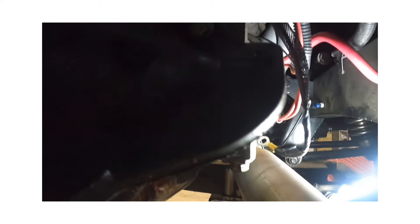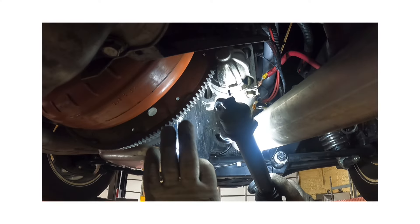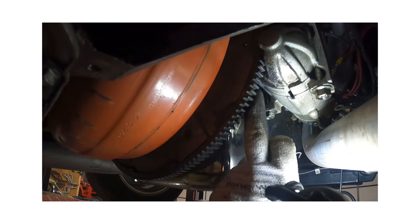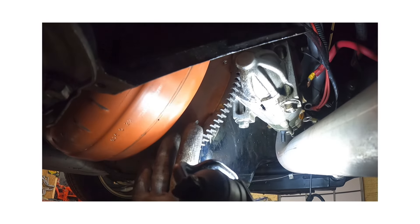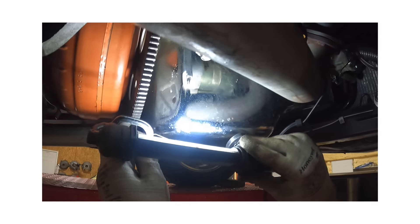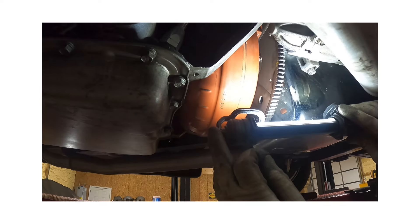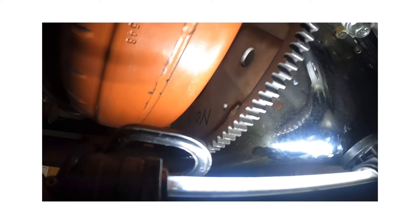I'm going to show you the shims that come with the starter. It's shimmed out too far — what was probably happening is if it's too close, it crashes the Bendix pinion into the flywheel, so it won't necessarily engage. It has tapers on the teeth to prevent that. But especially on a GM, you can see where it was starting to eat it. The flex plate's not happy — it's going to eat this flex plate up. See all those marks, all those high points? It was not making good contact.